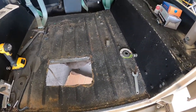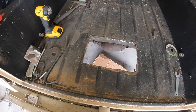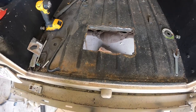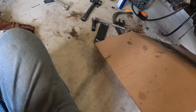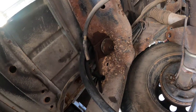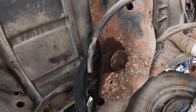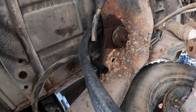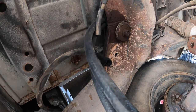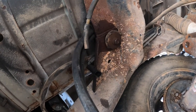So I may end up just replacing this whole pan back here — it's a little over $100 replacement pan, that might be the best way to go. Or I might just fabricate a hatch to go here so I can access the fuel pump and lines as necessary in the future. Another issue we ran into: right here is the problem — this is your body mount. These fuel lines come from the top of the tank, underneath or between the body and this cross member. Well, this body mount on the top end has collapsed. So at some point I'm going to have to pull the body completely off and replace all the mounts, but in the meantime I'm going to see if I can just put it back the way it was with the new lines and hopefully it won't pinch them off.